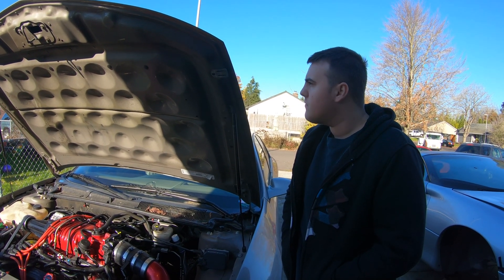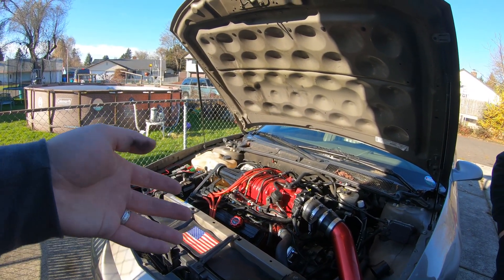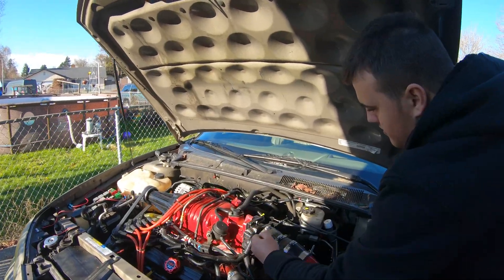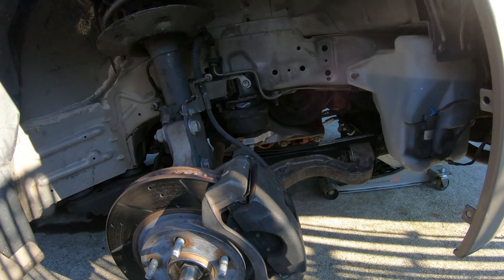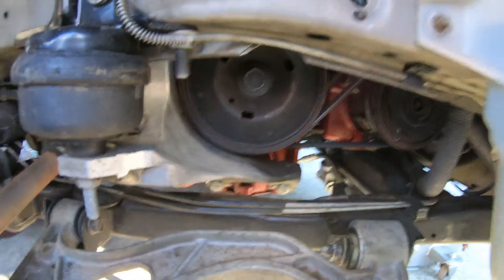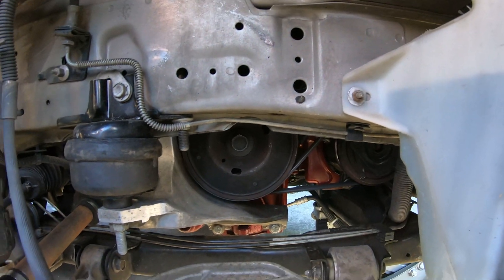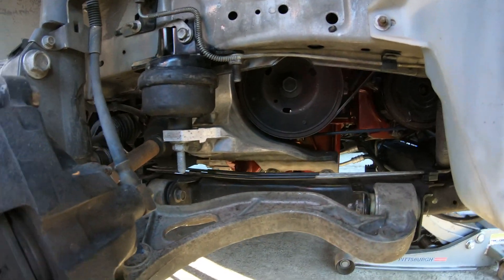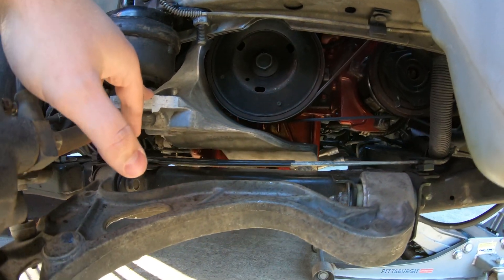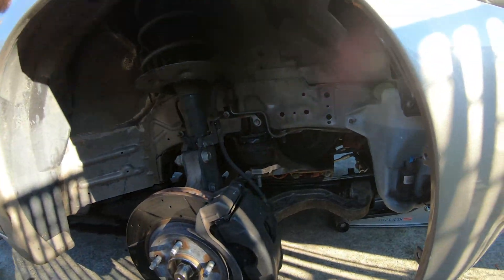See what it'll take to get the front cover off. People do cam swaps on these cars with the motor in, so we should effectively be able to take off the front cover. All right guys, we got the wheel removed. Looking in here, there's the balancer and behind it is the cover. So we actually have a direct shot with our big impact — just remove the balancer, which will be good. And then we'll probably want to remove this motor mount.